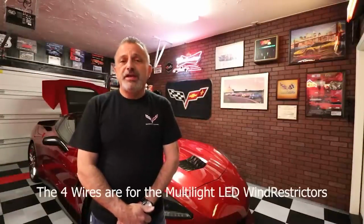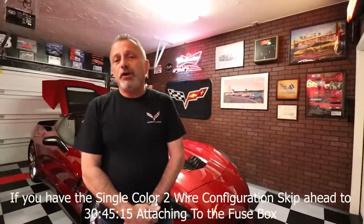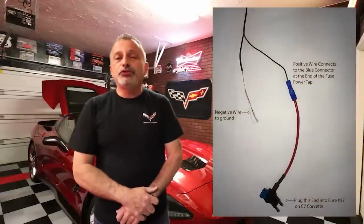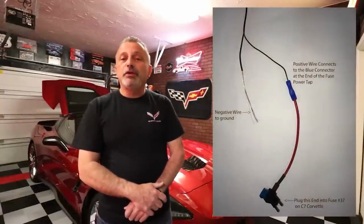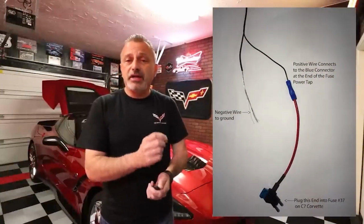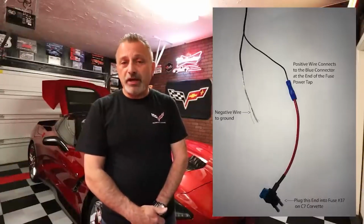In this section of the video, you'll be watching me install the multi-light kit for the multicolor wind restrictor. If you purchased a single light wind restrictor, you'll only have 2 wires and you'll be able to skip forward. I've gone ahead and put the timestamp up on the screen so you'll be able to fast forward to that section. But just to recap, for the people that have the single color 2-wire setup, I'm going to be putting a diagram up here on the screen, and it will show you the 2 wires, and that you're going to take the positive wire and connect it to the wire tap, and then you're going to put an eyelet connector on the negative, and that negative wire will go to the battery or the body ground, and then you will hook the wire tap itself into fuse number 37.